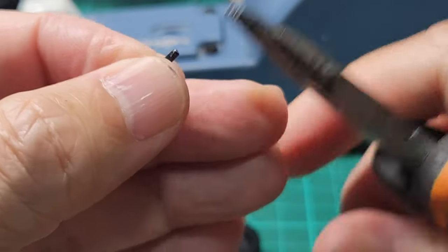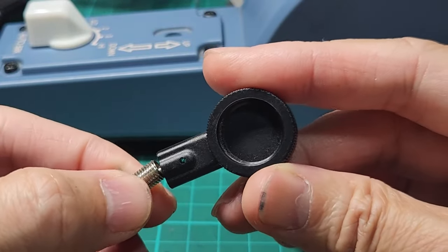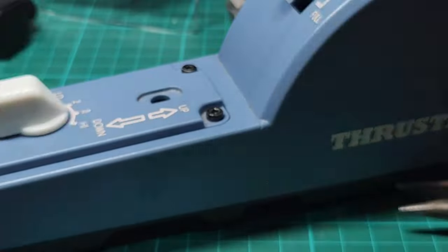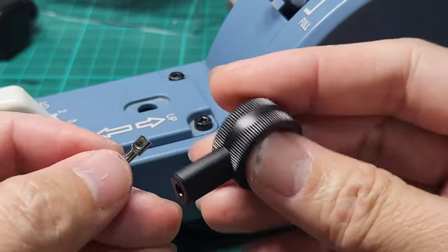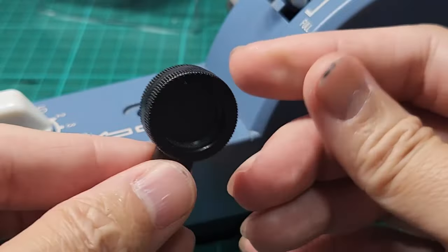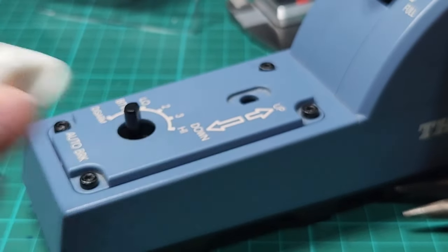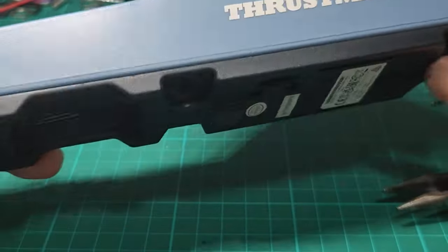This is it — this tiny little pin. And with that you will be able to pull this off, like so. Now of course in your case it has to be here first, but I already pre-removed this earlier. You cannot remove this cover without first removing this and this. So with these two out of the way, next is to pull this knob — you just pull it nicely like so. Now you are clear of all the obstacles and we can begin unscrewing this whole case.